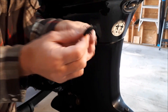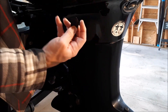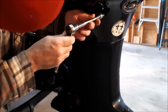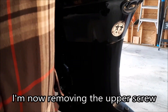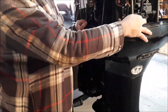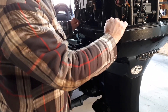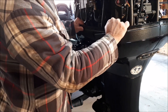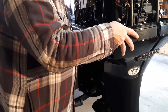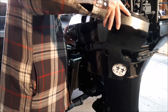Here's the plug — it just pops out, you just push it in or out. That's how you can get your wrench right in there. Now that you've removed all the screws, we can remove the lower cowling. Grab a hold of it and just jiggle it off — it's on rubber mounting brackets so just take your time. Get this side off, be careful not to drop it.